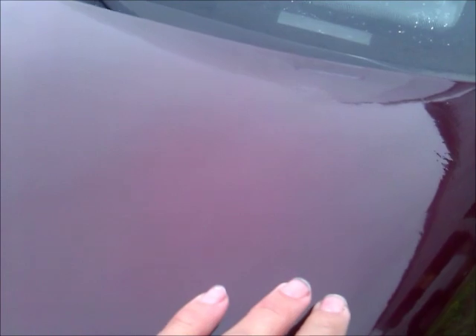After polishing, you can actually still see a trace of the run there and a trace right there above my finger, but for a homemade paint job nobody is ever going to walk up on that truck and nitpick it that bad. Now I can see them because I've been working on them, but for a homemade paint job, buffed and polished — the one that was on that hood just disappeared. This one I only sanded with 600, 1000, and 1500, then compounded it with the 3M compound and polished it with the Turtle Wax — and as you can see that looks awesome. And there you have it: how to get paint runs out of a paint job and make it look a little presentable.